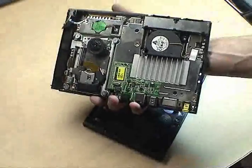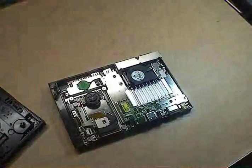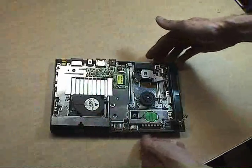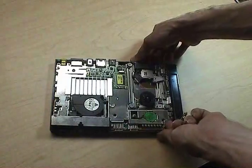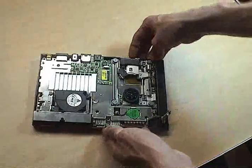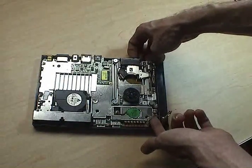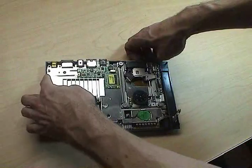With a little finagling it should come apart, and here you can see our slim PlayStation 2 system board. The top casing has absolutely no electronics in it and is not interesting to us at all. The PlayStation 2 internals are a little bit fragile; they're actually composed of multiple boards all sandwiched together. The entire board assembly comes out as one unit, but it doesn't just lift out — there's a trick to it. There are a few safe places to grab the board: one is here, and there's a loop of metal that sits underneath the CD mechanism. You can also put your finger under the shielding to lift up one side, but the far side won't want to lift up. There are some clips along that side that you'll have to pry up with a small flathead screwdriver.